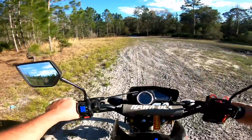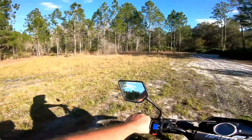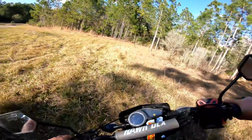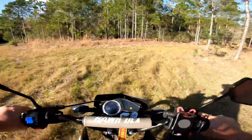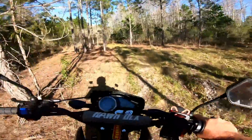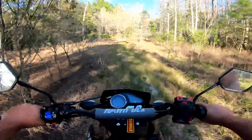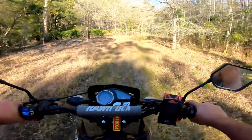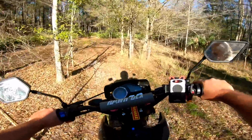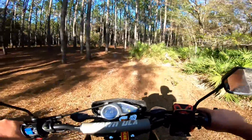So next trip down, I'm gonna order myself a, I think I might go back to a 15. Yeah, there's a good trail I haven't tried yet. Might be a snake or a turtle or a big spider. Yeah, I'm gonna go with a 15 tooth in the front because I have a 45 in the back. That'll make it pretty close to a 1750. Close.